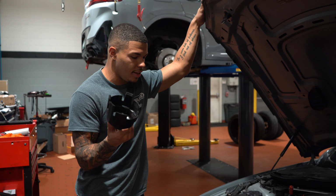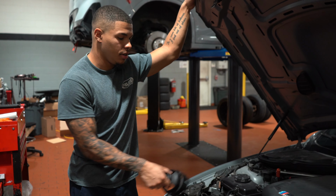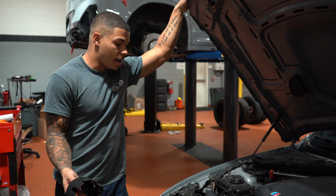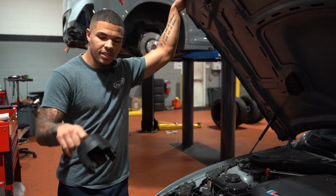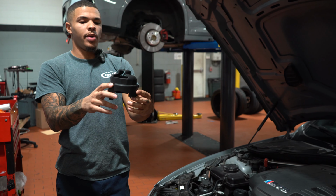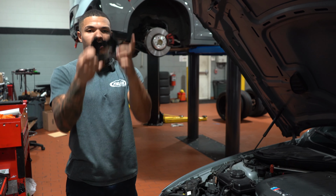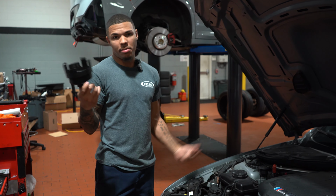It's actually to prevent the oil filter housing cap from backing out of the housing. Why it does that, nobody knows. It might be vibration, it might be the amount of pressure that the oil filter cap is under. But this essentially locks around it, and it prevents it from turning either way, and it also prevents it from coming up. The way to take it off is, you see these little tabs down here, you pull out, pull out, and then you pull up.